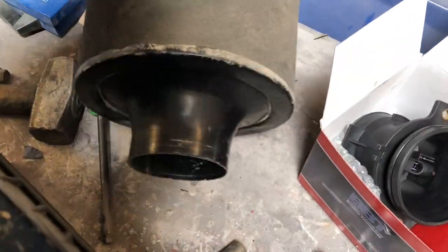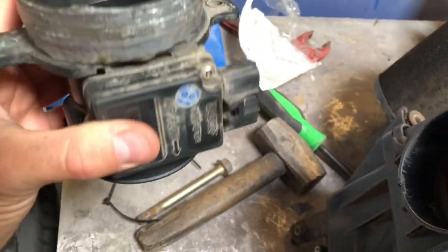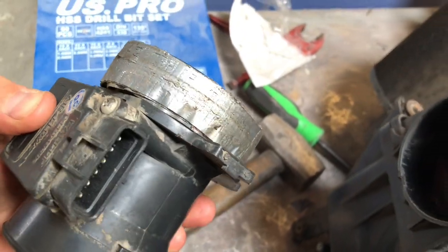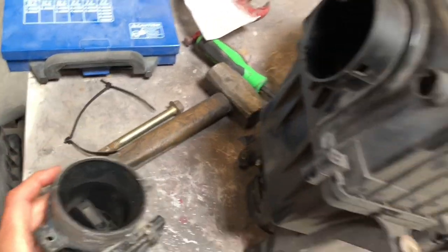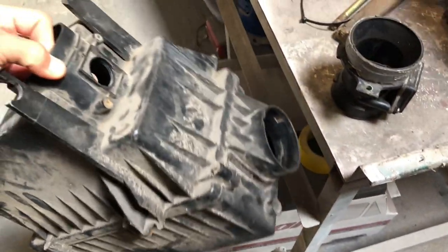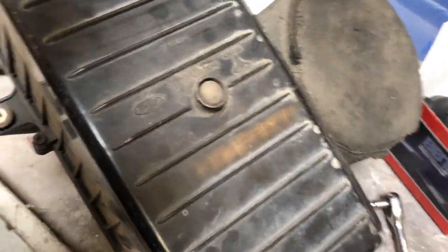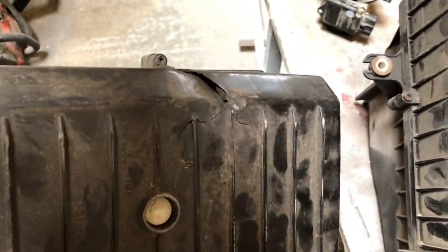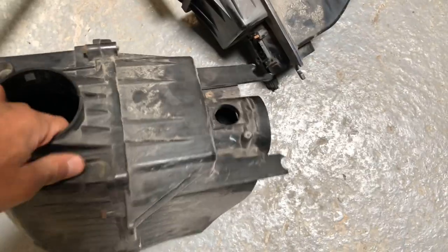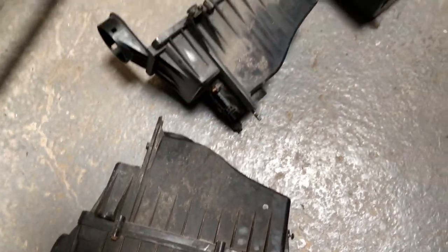The old filter was doing no filtering at all - you can see the amount of dirt getting in there. It was absolutely disgusting and properly bodged on with gaffer tape and all sorts. We've got two air boxes - one has a cracked lid and the other has problems with the studs in the MAF housing. We're going to make the best of both by swapping over the good lid. These are actually expensive air boxes to buy because it's a specific part for the Mark 1 RS.